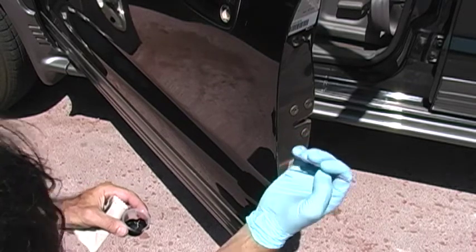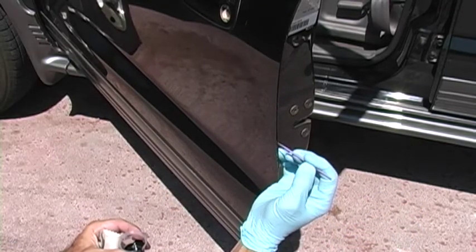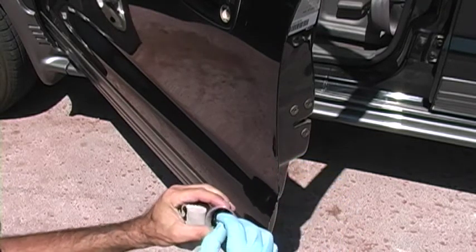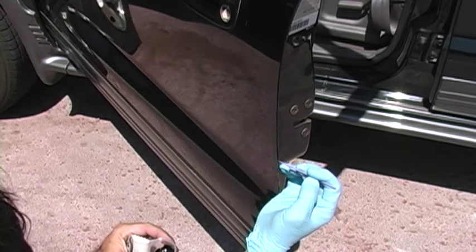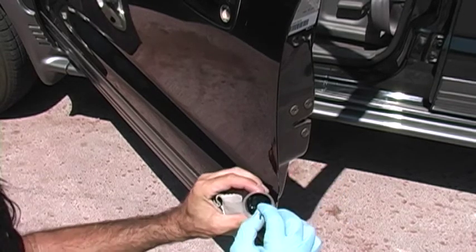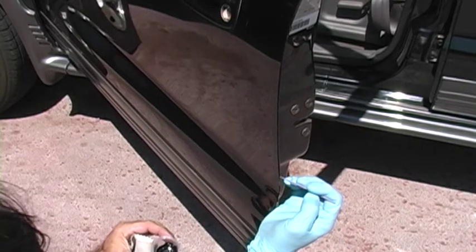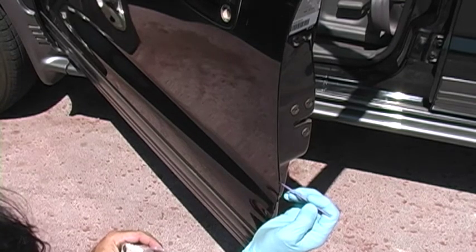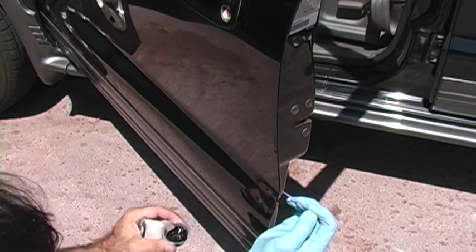You don't want to play with the paint — you want to lay it down and then move on. If you try and work the paint you've already laid down, it dries so quickly that it'll just blob up and make a big mess, and then you'll have to remove it with lacquer thinner and start all over. You can see how quick this is — there's really nothing to it. You can get a really nice result and make the door edge look really nice, which is especially noticeable on a black car like this where white chips really stand out.